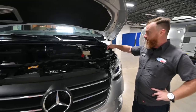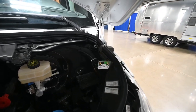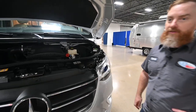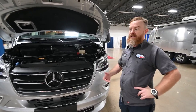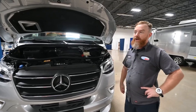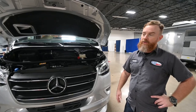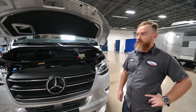The last thing under here is the air valves for the rear air suspension. This has a built-in air compressor and the air suspension is automatic. But if that compressor fails and you needed to manually add air to the van to lift the rear up — basically just to get it on a flatbed — you'll add air here. It will be nearly 100 psi to get it to move. Set it to right about 100 psi and you'll be able to load it on a flatbed and bring it in for service.